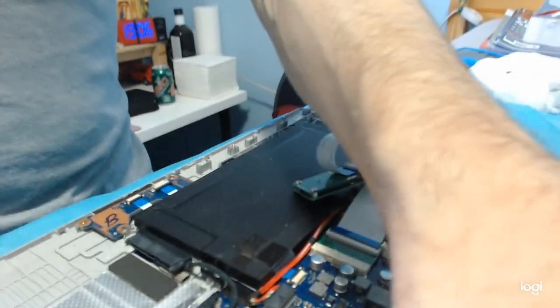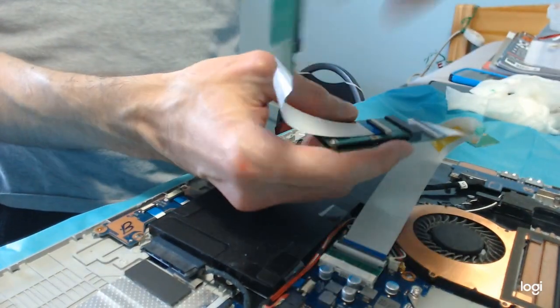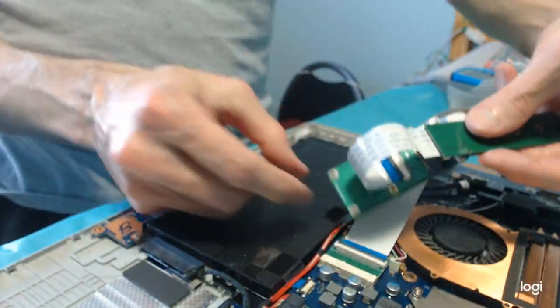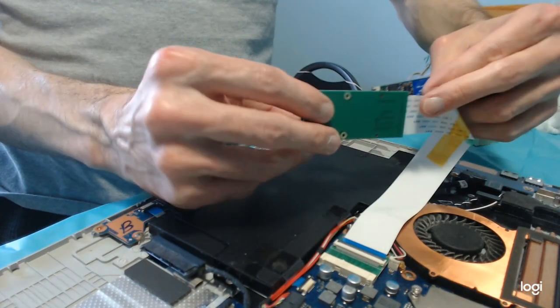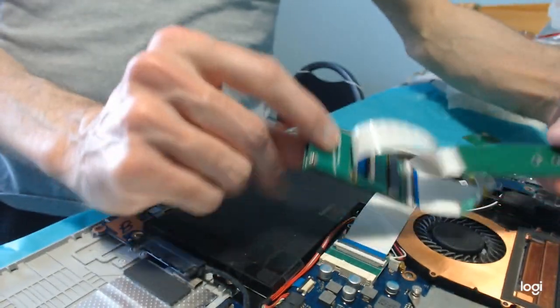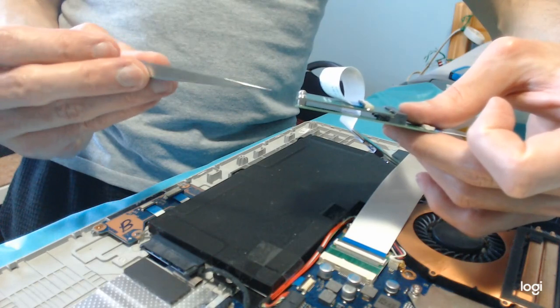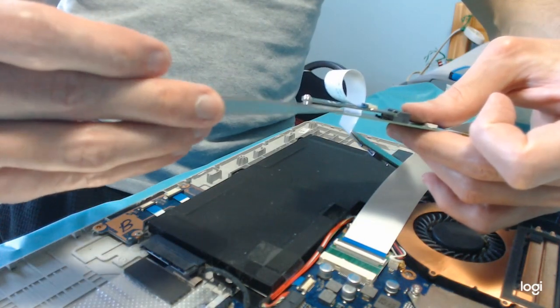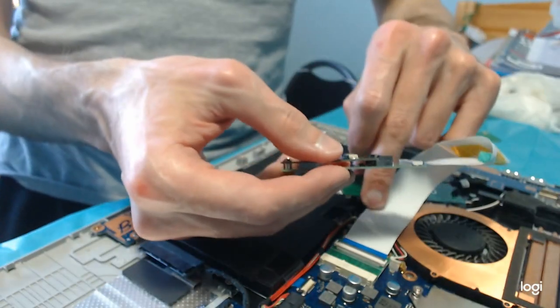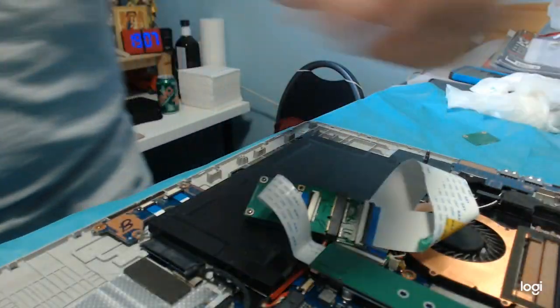Now what I'm going to do is this, to help you see what's actually going on here. So, extension, adapter, drive. The two screws, I've screwed the adapter to the extension, to the little board of the extension cable. But I'm gonna add two more screws there, but there is, see, here we've got the thing in which the screws screw. Here, no, it's empty. So we're going to use two more nuts and bolts, the same that I've used here, which are just the right length.